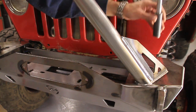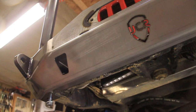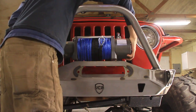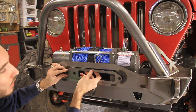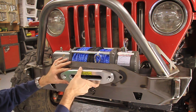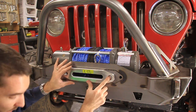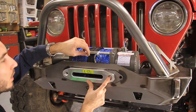For now I'm just going to install it as is. There are four bolts on the top and a couple on the bottom. I'll set a winch in here just to show you what that looks like. Depending on your winch, you can flip-flop this thing around to make it fit right, and then you put your fair lead on of course. There are bolts provided for that as well, and nuts for the backside. You should probably put the fair lead on before you put the winch on — that would be the smart move.